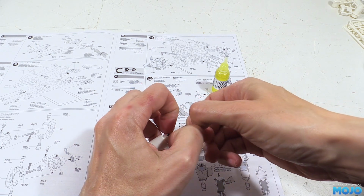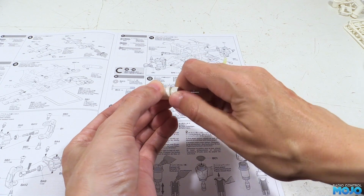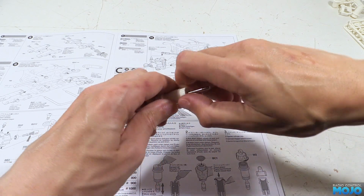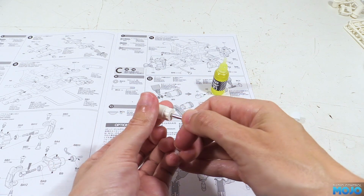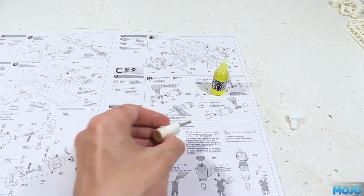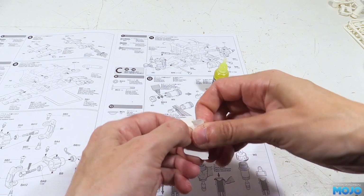Make sure the O-rings are all nice and oily, then offer up the bottom cap and thread it on. It needs to be bottomed out, but only as tight as you can go by hand. There's no need to attack it with a pair of pliers. You should find the shaft moves up and down in the seal fairly smoothly. Now it might catch a little bit, but that should just be the piston in the body that hasn't got any oil yet. Next is the rod end that needs to get threaded onto the threads.